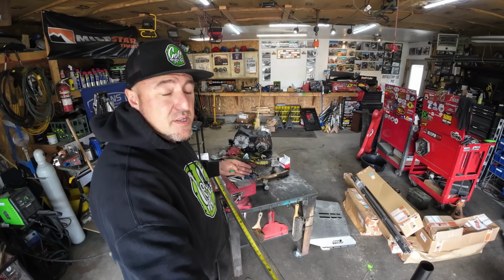When I did the cage for my two-door Cherokee, I used a DNC Extreme pre-bent cage because it was already designed to fit inside, weld up. But I only did the front because I didn't have a back seat, so I didn't really care about having the design in the back. And what I'm going to do here, though, because these are the tubes that went into the back, if you were going to cage the back out for passengers, is I'm going to use that. I'm going to cut them down a little bit, and I'm going to set them out this way to clear, just so that I can set some plates down so that your feet are a little bit safer inside. So when your feet are swinging around, when you're in this chair and you're swinging in circles, your feet don't accidentally catch a tire.